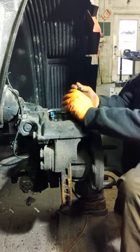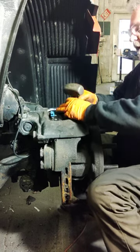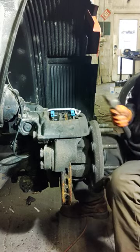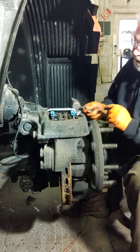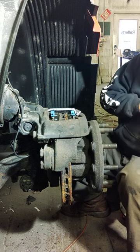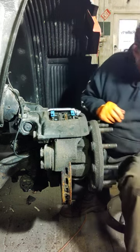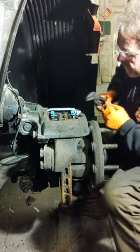Put that clip on. It was a matter of closing this back down so we can put the pinhole, and it should be relatively easy. There are two ways this can go - you want to put it on the right way. You're going to push this home. I did it with a pair of pliers. Snap-on probably makes a tool for that, but I'm going to show you shade-tree stuff - just pick it, put it home, then run a little punch in on one side just to hold it there. Work it back and forth so that when the new pin goes across, it'll run home.